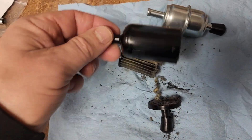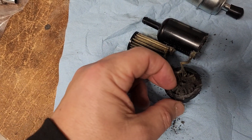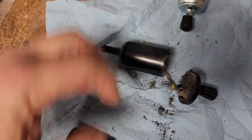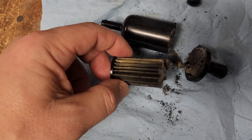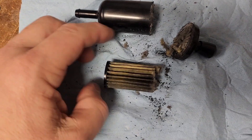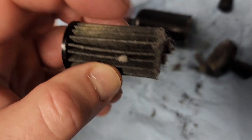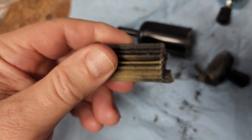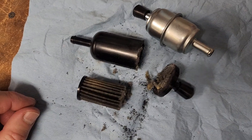Although I have to admit, this old filter was extremely hard to cut open. I tried putting it in a vise after I'd partially cut it to see if I could crack it open, and I couldn't — I had to cut it all the way. So this black fuel filter, if it weren't for it being dirty, I wouldn't change it; it just seems pretty strong. Maybe they fail too. But because of the debris in here, it's definitely worth, in my opinion, changing it at 40 hours. And then you'd be good, I believe, for the life of the fuel pump.